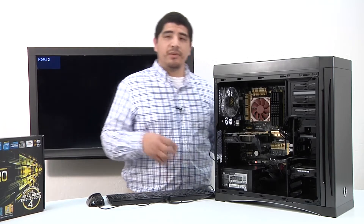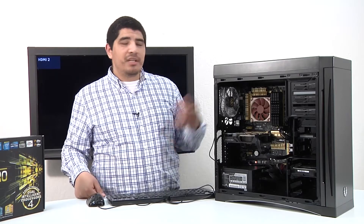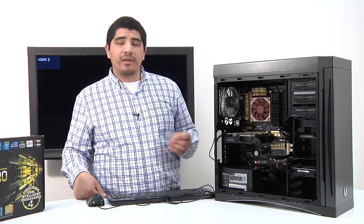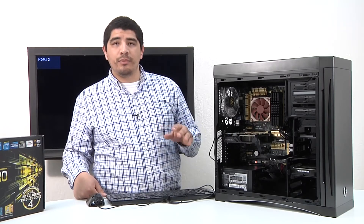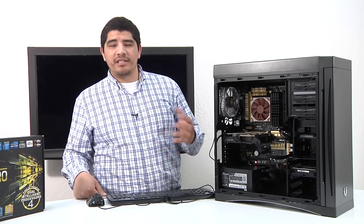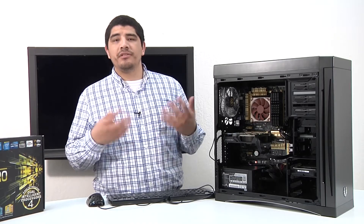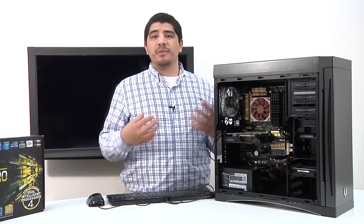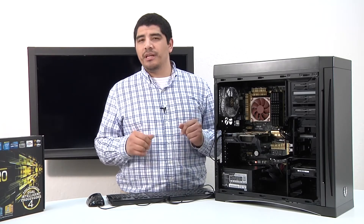So at this point, we're essentially just going to be doing a test fire of the system and confirm that everything's working. We didn't cover it in this video, but if you really want to be super safe, it's generally recommended that you install the CPU in the motherboard, put on your CPU cooler, put in the memory, and essentially test everything outside of the box first to see if the system responds. This will of course save you a lot of headache afterwards if there ends up being a component that's been damaged or compromised during the installation process, at least helping you to know that originally everything was working.